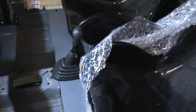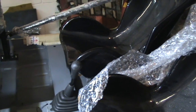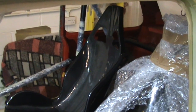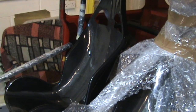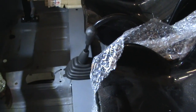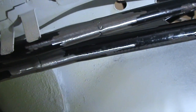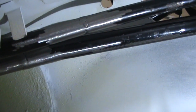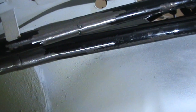Just back to the interior of the car. I've got the seats in the position I want them. I'm six foot two, fairly long in the leg, so the seat is fairly well back - way past the B-post, as you can see. I'm probably some six inches further back than a standard Mini seat. Consequently, the gear change - this is a Nissan lever and gator - is about at least six inches back from the Mini position. Just so you can see, the two linkage pieces where the paint's been abraded were just rubbed down. I took about a 50mm section out of each one on the straight sections, then sleeved and re-welded. So they've fitted fine, no problems at all.